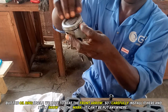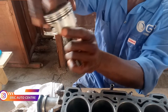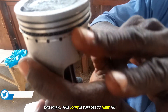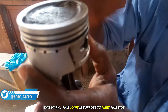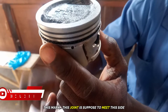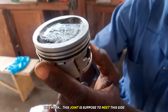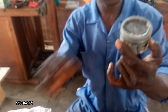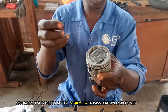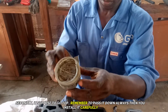When you position it, this mark — this joint — is supposed to meet this side. The reason is that when you fix it here, the pressure will make the oil rings run out quickly. So you have to bring it into the internal combustion chamber so that it will last longer. The second one is supposed to go on top — always pass it down to install it.